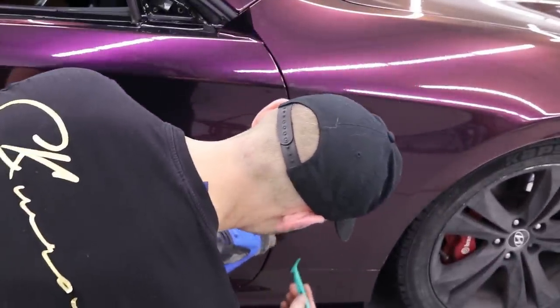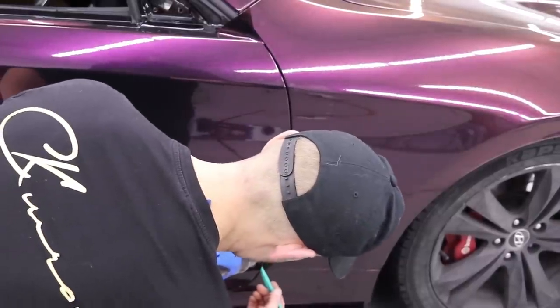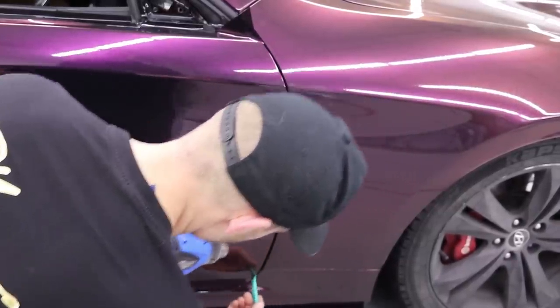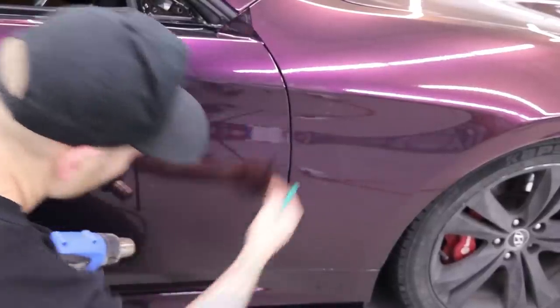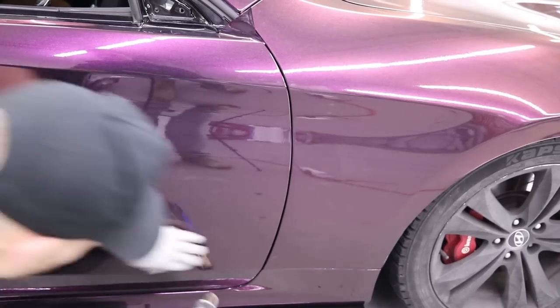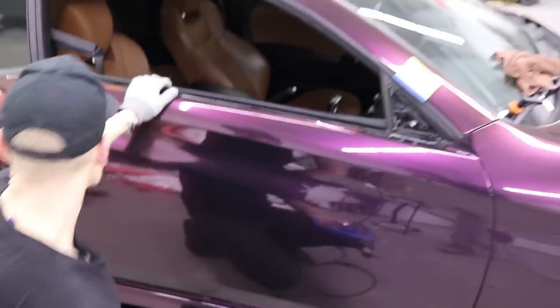Now, keep in mind, once we get around, we're good. And if we have, over time, maybe any excess vinyl hanging off or whatever because we didn't get it stuck down to the other side, it's not the end of the world. You can go in there, back of the blade, and trim it all off, as long as you're not showing any exposed paint. So just a way to deal with that.